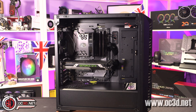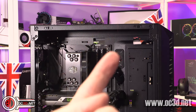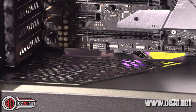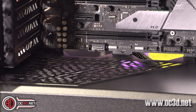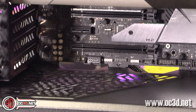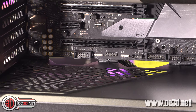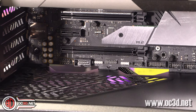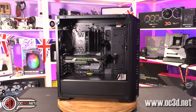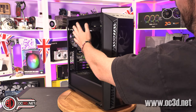But for the love of God, don't buy the tempered glass one — it really restricts airflow. No matter how many fans you put in the roof, you need more air coming in the front. The PSU cover has mesh cut in so you can mount the power supply either way — fan up or fan down — it makes no real difference to performance or temperatures. You can fit a 120mm fan in the PSU area comfortably.